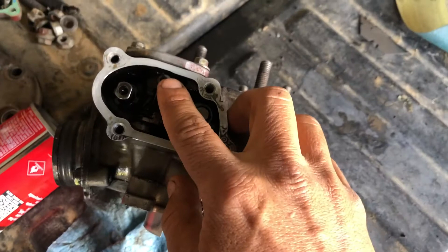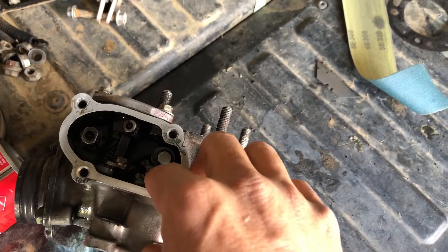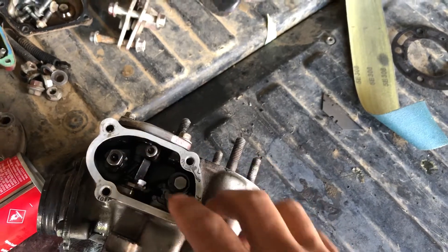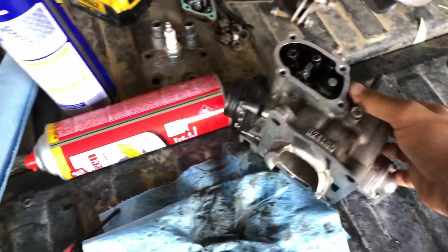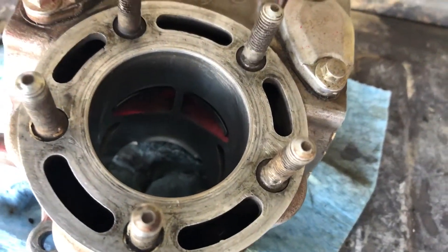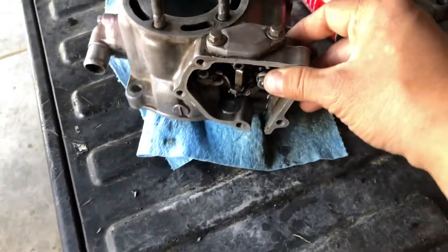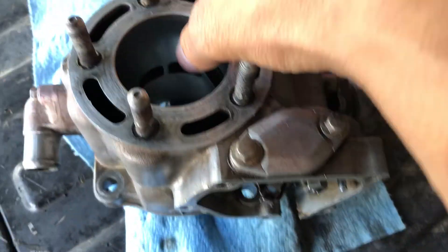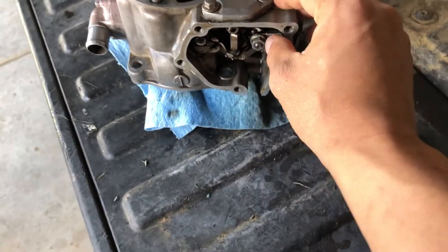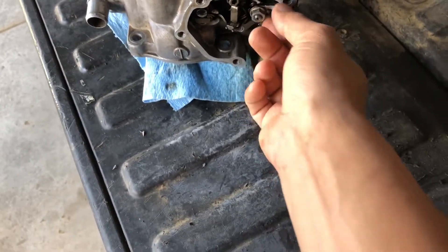To be honest, these were not very hard to adjust. The adjustment is to loosen up this bolt, push them in, put some tension on here, and then retighten it — it wasn't very hard at all. I'm going to send this off to Millennium Technologies to get repaired — I think that's plating I see in there.